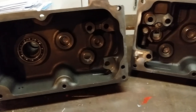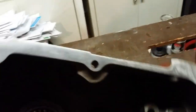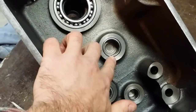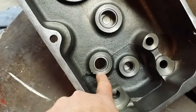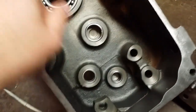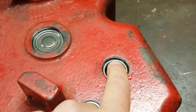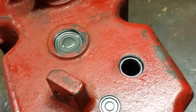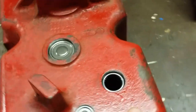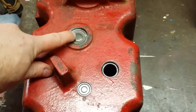Down in the basement now because it's too cold in my garage. All of the bearings are installed. I'm going to tip them up so we can see a little better inside. As you can see, I have each one of the bearings just a touch below the internal face, especially the closed ones. For the open ones, you just need to be mindful that they don't protrude past the face, but also provide enough room to be able to install the grease seal or oil seal. Basically split the difference — measure your seal thickness and make sure you've got enough room.